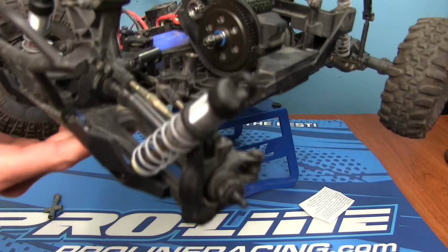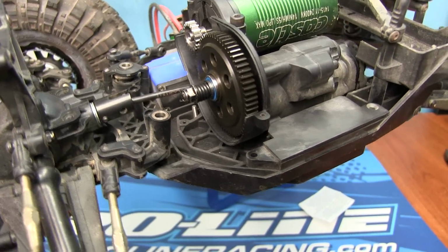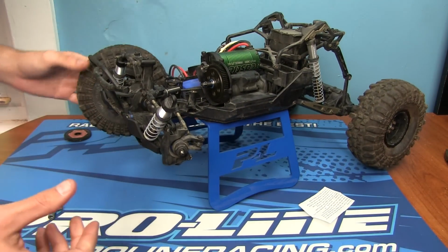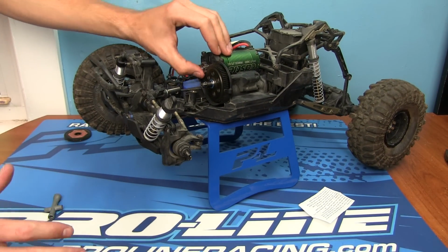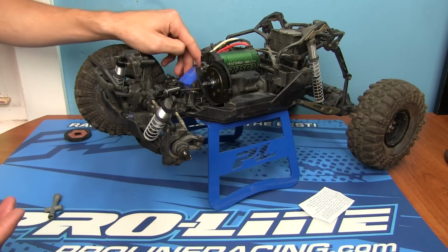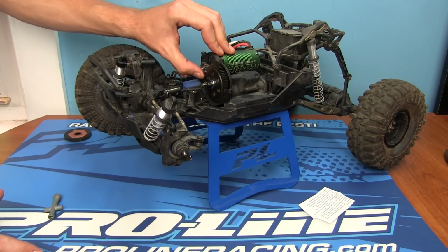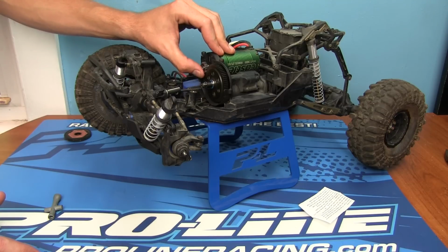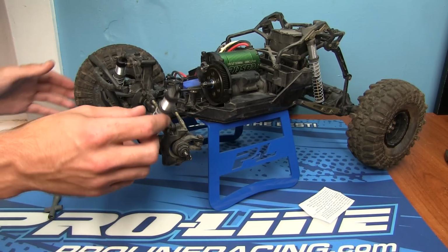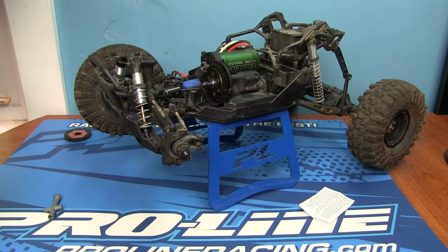Bring that a little closer so you guys can have a look. There's the Robinson Racing slipper clutch gear. All the information about this product will be in the description box. And that's that. So we are now one step closer to getting this thing back up and running. I just need to swap out this steering servo, get a new one, and we are back on the road again. Also note that I did change out my pinion gear from a 16 tooth to an 18 tooth. So trying to get a little more speed out of it, and we'll see how well that works.